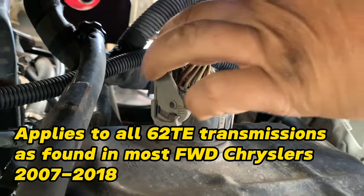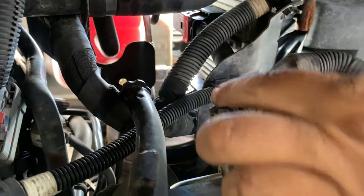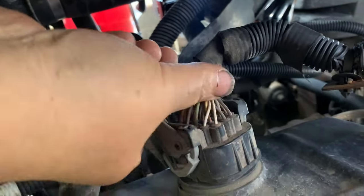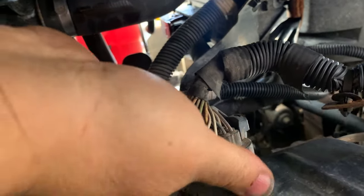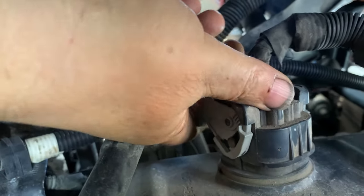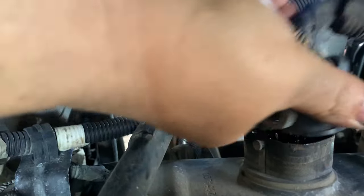Pretty straightforward, although you wouldn't know it to look at it — and difficult to film as usual. With one hand squeezing down on this center section to release the tang and allow you to push the armature back, and now with the other hand upside down, burning my arm on the catalytic converter as I rotate this back, you will see the plug. Now that it's free, that plug should drive itself out. The light is falling off the head, also the pants are falling down and the ass crack is completely exposed, thus slowing the property values here in Barberton even more than normal. There we go — and as you can see, see how this armature rotates and it pivots, and things happen, and thus the old gal, let's go.